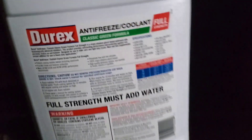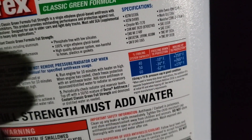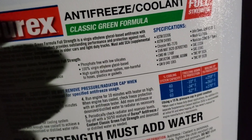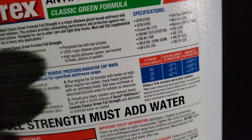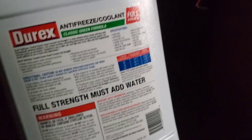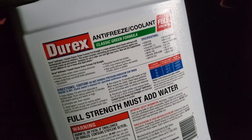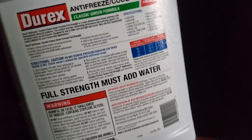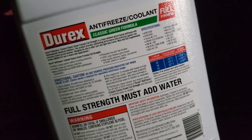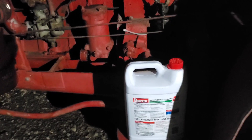The folds are still warm. Green juice time. For where I live we need cold protection — we're going to go 50/50, which gets us to negative 34 degrees Fahrenheit. We don't see that much, but occasionally we'll get down to negative 15 or negative 20. You want to know it's better than it needs to be in case of a really bad cold snap, so you don't have to go out and repeatedly add green stuff and drain water trying to get the mix strong enough. We're shooting for 50/50 at negative 34. I mostly look at the freezing number — I'm going to throw some green stuff in there.